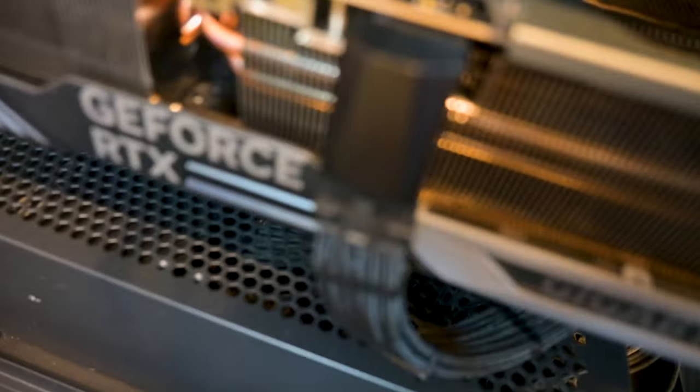So I'm gonna run this one more time. I'm gonna go back to 180 on the GPU clock overclock and run this again. And I just wanna point out, for whatever it's worth, that those settings got me in the top 13%. Not top 100, but you know, the 4090 leaderboards are pretty competitive, lots of water cooling going on. So I think for having a tough version of the card, this is pretty good, and I'm gonna leave well enough alone. Running Port Royal now.